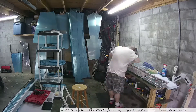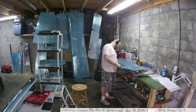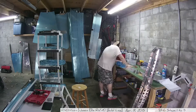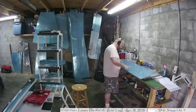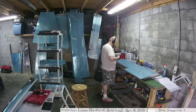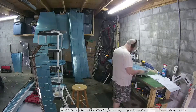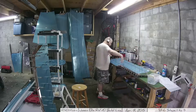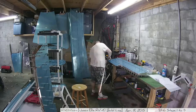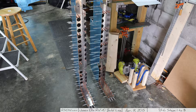Here I am on the other side doing the same work all over again. I'm wondering if you guys like this camera location or want me to try another view - leave me feedback. Removing vinyl - seriously, there's got to be a better way. This is me putting the top skin on, and here's where you start to realize how important some things are, like which skin is which and whether you correctly identified the top left and rights. The shear clip placement is important - you put the skin between the bottom skin and the shear clip, because when you do the match drilling, you drill through the shear clip into the two skins for reinforcement. I'm also positioning the trailing edge wedge. There's more video, but I'll show it next time. There are the two pieces I've done so far - awesome stuff, see you next time.